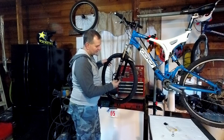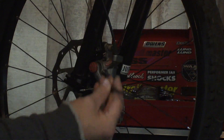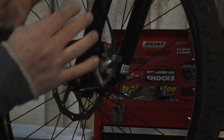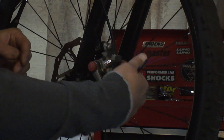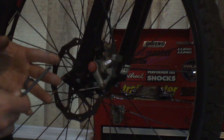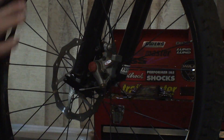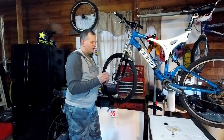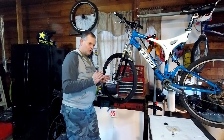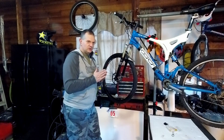You can make some adjustments with the cable if you need to. There's a barrel adjuster up at the actual brake lever you can make some adjustments with. On these it's a five-millimeter Allen wrench — I can loosen this up, move this arm, and adjust the cable. I can also adjust the outer and inner pistons. On these there's a little turn dial. On some of the Walmart brakes you have to use an Allen wrench from the backside to adjust the inner pad, so the inner pad is not going to rub directly on the rotor. You want just a little bit — maybe slip a business card between that and the rotor.